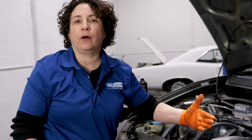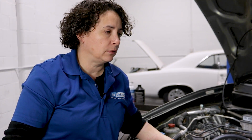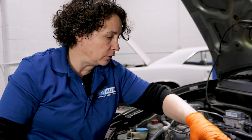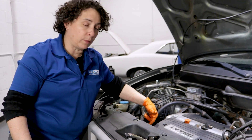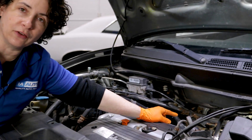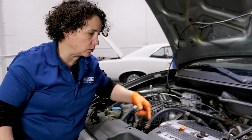At first I was like, does this water pump not work? But that was while it was still heating up. Then the fans came on and I checked the gauge — it's perfect, right in the middle. So that tells me the water pump is circulating. We're not having problems with the car overheating on the road, so the water pump is probably doing its job. The engine's getting nice and hot, the upper and lower radiator hoses are hot, but the back of the water pump is cold — because this valve has not opened up to circulate the hot coolant.